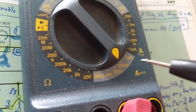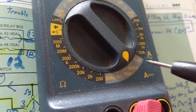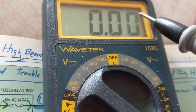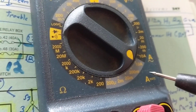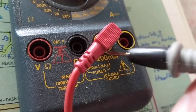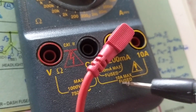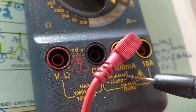200 milliamps — 'm' stands for milliamps, which is one-thousandth of an amp, much smaller than an amp. The highest this meter can go is 10 amps. This meter doesn't display which range you're on. The highest is 10 amps in the 10-amp input hole, and 200 milliamps in the other input. Both inputs are fused. Do not mistake 200 milliamps for 200 amps — they are very different.